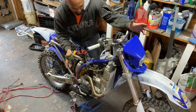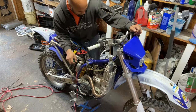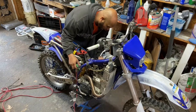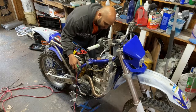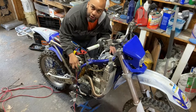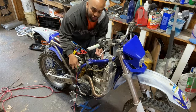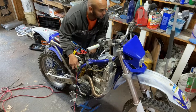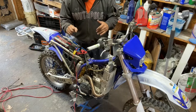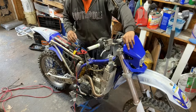Alright, we got it all back together. I put a new pilot jet in to see if I can get it to idle, because as soon as I let off the choke it would want to die on me. I replaced the main jet with a 160 — that was already in it — and the pilot jet was a 50, so I replaced it with exactly what was in it. I do need a new hot start; the plug and plunger looks like it's still down in there. It runs a little lean because once I goose the throttle and let off, it still wants to rev high.